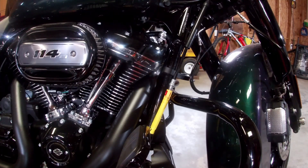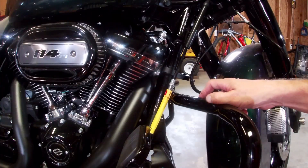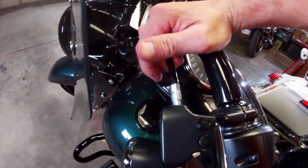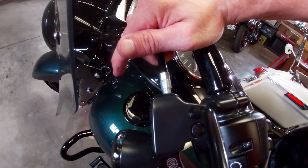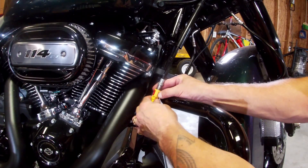However, I've been noticing that some bikes have a clutch cable that's routed poorly or has a steep twist in it, and the cable doesn't move smoothly enough for the spring to take up enough slack. If you just let the spring take up all that cable, you still have too much free play — still a good quarter inch — when the specification is 1/16th to 1/8th inch. So the spring is not properly doing its job, and that makes it hard to find neutral.